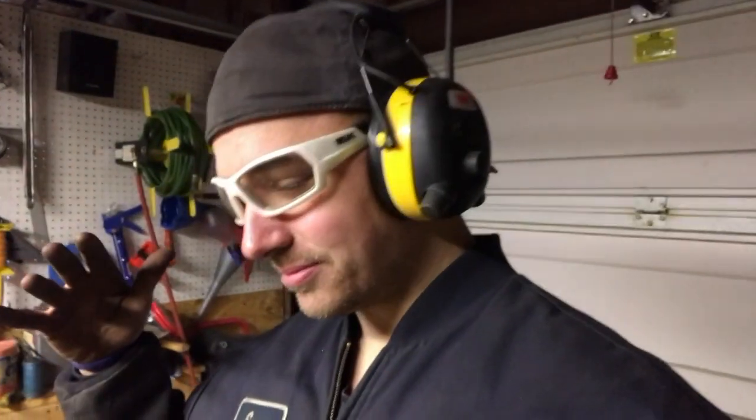I think it might be that half link, because that shaft sticks out, and I've had problems with them before with torque converters. They hate torque converters. So I'm thinking that's the problem. But I'm just excited it started up. I mean, that thing started in a couple of pulls. I was surprised because that thing's been sitting there for quite a few months. So that's cool, the engine starts up.